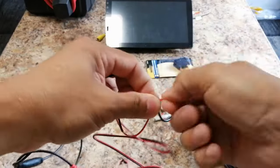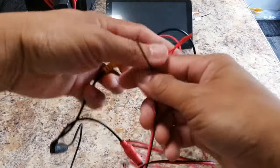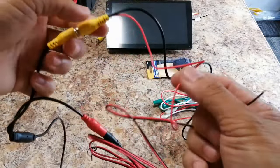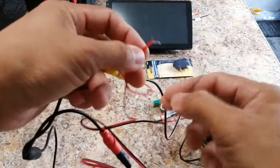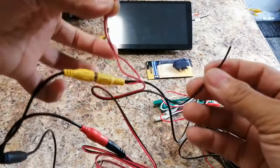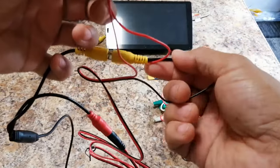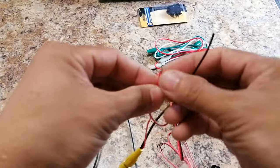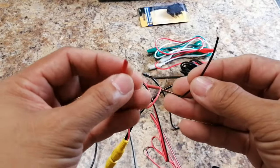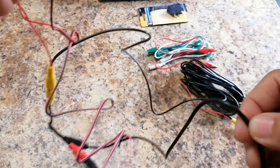So they join together — this is from the camera, this is the 12-volt supply for your camera. And to make it clear, that red wire from your video cable — both red wires are together. So these two red wires are going to go to the positive line of your reverse light, and then of course the ground goes to the ground of your reverse light. Okay, that's the camera — the other end of the video cable.